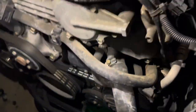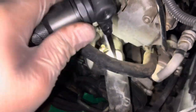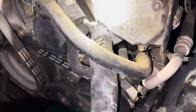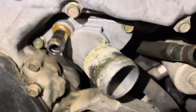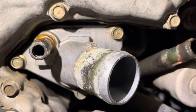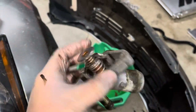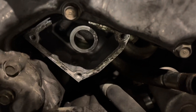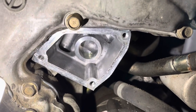While I have the radiator out and more space to work, I'm going to replace the thermostat. First I'm going to remove this hose since we're replacing it anyway, as well as this one. Then I'll unhook this hose right here. The thermostat housing is held in by three bolts. Once the hoses are out it's pretty straightforward to remove. I got all the hoses out, I'm taking out those three bolts, and now I've got the thermostat housing out. I'm going to clean the surface a bit.